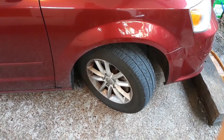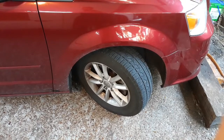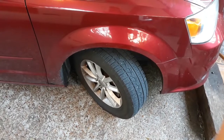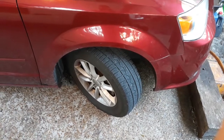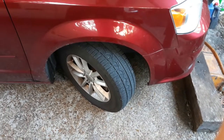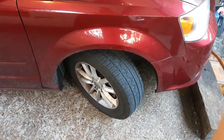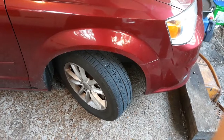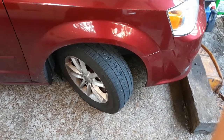That's it guys — just a little update video. I've got these tires about halfway through their life and they're wearing well. Should you run standard SL tires or XL tires? Ask yourself: are you having tire wear problems? If you're not, you're probably okay. But if you have more wear on the outside than the inside, that's an indication of overloading or under-inflation. If you stay on top of tire pressure and it's still happening, that's an overloaded tire problem — and XL tires could solve that. Y'all have a good one.